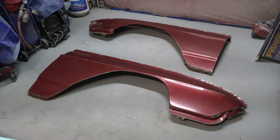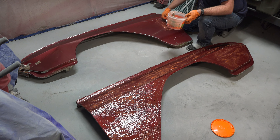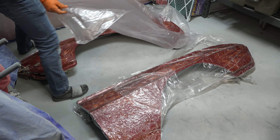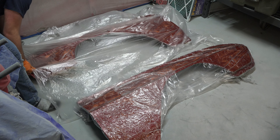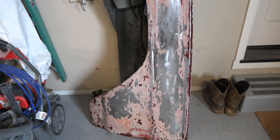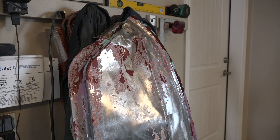First up, I need to remove all the old paint. I've had a lot of good luck with citrus strip so far, so that's what I decided to go with. I go ahead and literally coat the fenders with citrus strip, and then cover the fenders with plastic sheeting. The plastic will help lock in moisture, allowing the stripper to work longer and more effectively. After letting the fenders sit for 48 hours, I pressure washed all the citrus strip off, and was left with a relatively clean surface — the citrus strip had no problem taking a majority of the paint off down to bare steel.